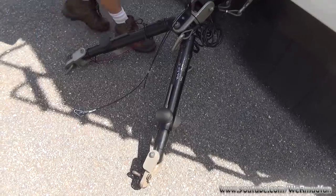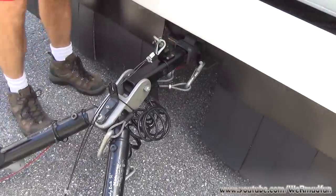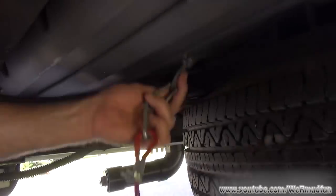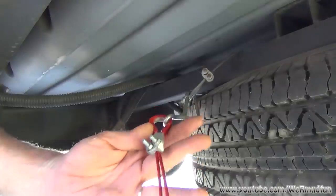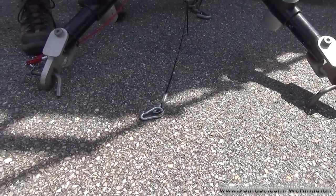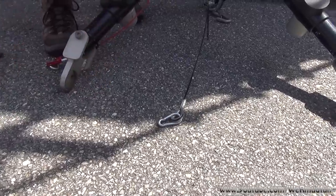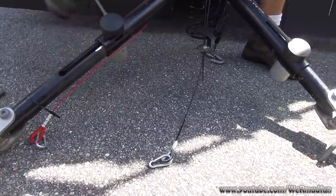So now, as you notice, the safety cables are already attached. Underneath here, this cable right here is attached to the frame of the RV, and the breakaway is attached to that. The first thing we do when we're preparing to hook the Liberty onto the RV is we pull the pins, turn this lever, and extend the Ready Brake out as far as it will go. Do the same on both sides.